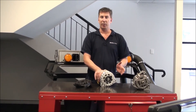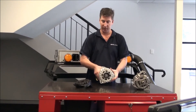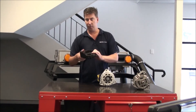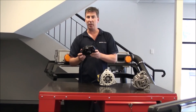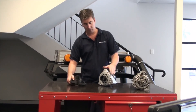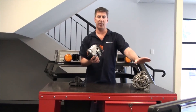When we designed it, we really wanted to make sure the front cover was going to fit before we manufactured it, because as you can see it's billet — it's machined, it's a lot of work. So we used our own 3D desktop printer and rapid prototyped a plastic cover. We printed it overnight, probably cost us maybe two dollars. In the morning we got it out of the printer, tried it on, it fitted perfectly. So we were happy to then spend the time to machine up a piece of aluminium 6061, and we've now got a 370 amp alternator that will bolt directly in where the factory alternator went.